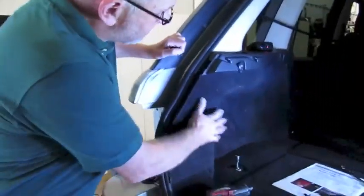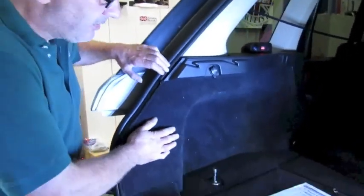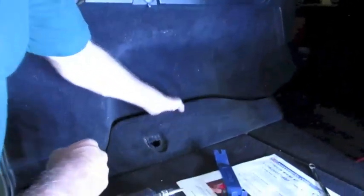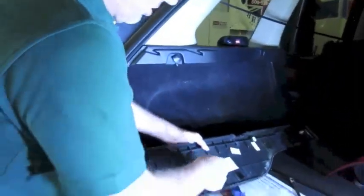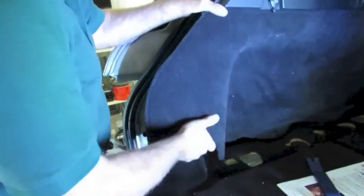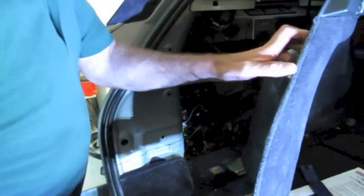Now that we have the lamp out, the next step is to remove the left rear quarter interior panel. To do that I want to ensure I remove the bottom panel here first, because it's fouling on the bottom panel. To avoid damage to any of the panels, I like to remove any necessary fixings first. With the two luggage clips removed, a little tug on the back edge of this panel will remove it. There are a couple of locating dowels — looks like one of the clips has been damaged in the past, we'll be replacing that. That gives us access to removing the rear quarter panel.